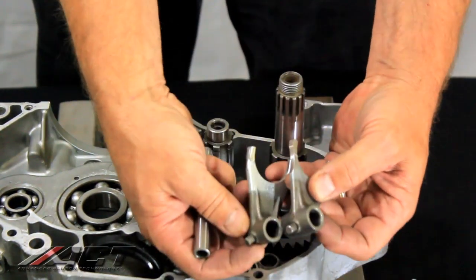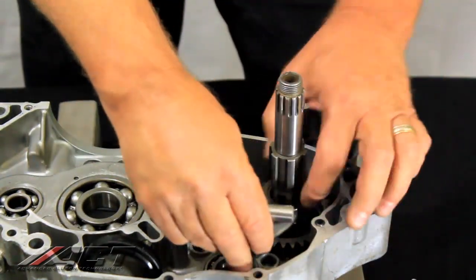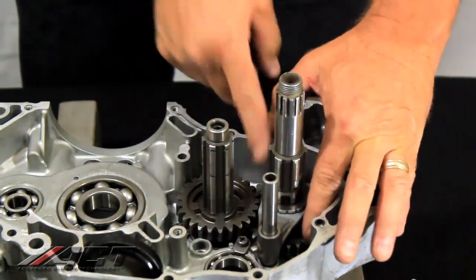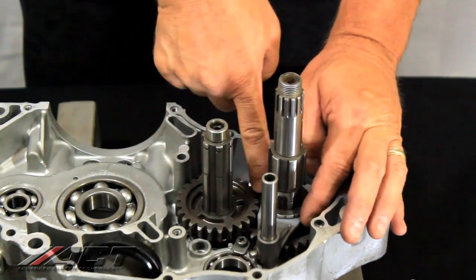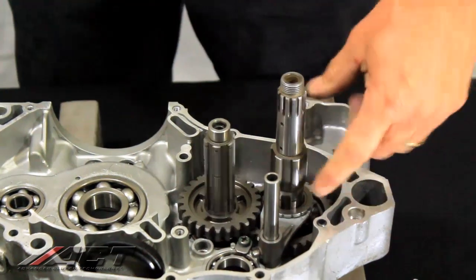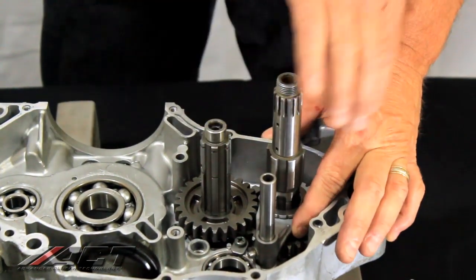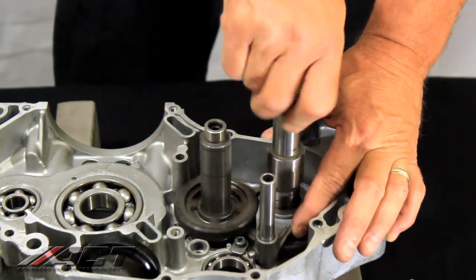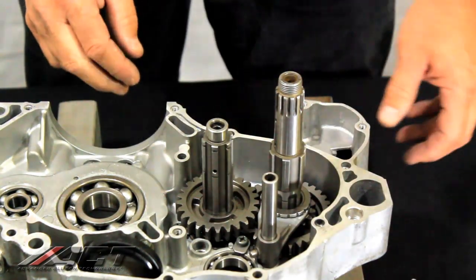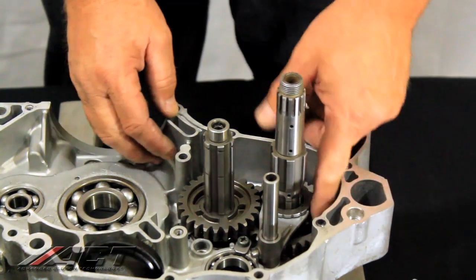In order to allow that to clear, the shift fork has to look like this one — you can see the difference there. So let's put the modified shift fork in place along with the rod. Once you're shifted into first gear, everything still spins free. I can push the shift fork against the primary shaft a little bit towards that direction and everything still spins free — there's no interference any longer. That's how you check for proper clearance: drop the pieces in place and make sure everything spins.